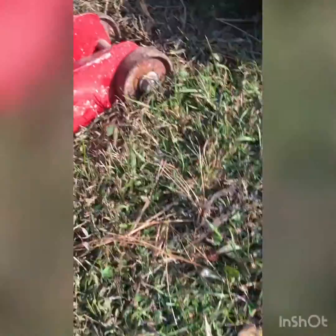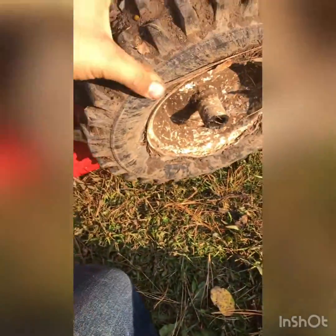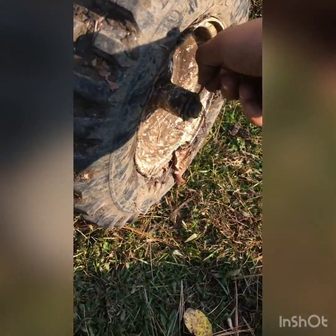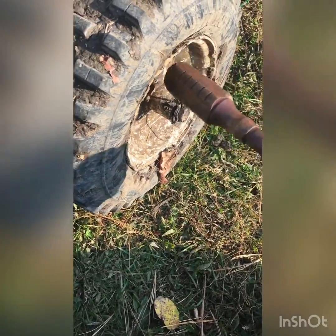You have to pull the tire off — this one has zero washers on it. So I'm going to grease her up and find a washer. I managed to find one, so that's going to have to work. This goes on like that. I got to move my jack because this moves around — my tire was hitting it. Now you throw that on like that, put this in there, take the screwdriver, just get it on the other side of the washer. There we go. Now she's all good to go.